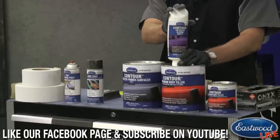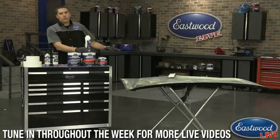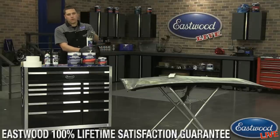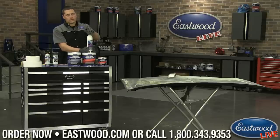If you're not quite happy with one of the edges, it's just ever so slightly undercut, meaning that the metal is just slightly higher than the edge of this, this has slight filling capabilities, so certainly not a problem to put it over top and finish to smooth it off. It can also fill any of those deep sand scratches. Now with this, you're going to want to take it to about 180, or 220 if you move on to, say, a urethane high building primer, because with the urethane you're going to need that 180 to 220. But this is a great option.